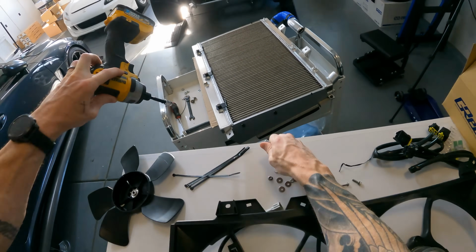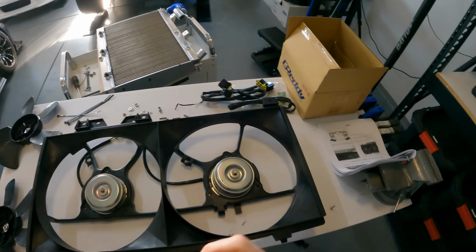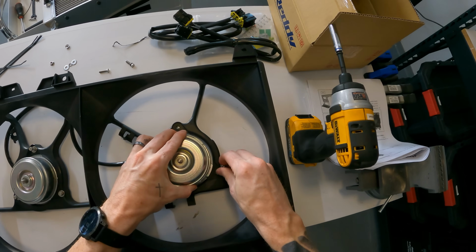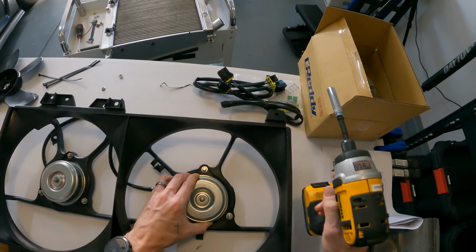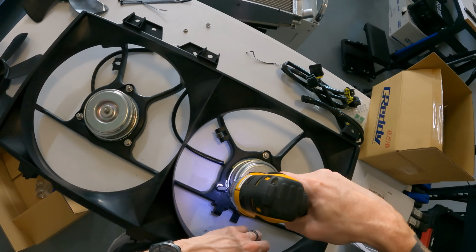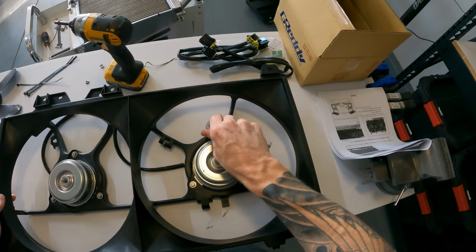But those brackets are spot welded on to the frame rails, and they were just completely missing. That wouldn't be such a big deal if I was also doing something custom, but I'm building a very off-the-shelf sort of car, and the Greddy V-mount, both the radiator and the intercooler, rely on that crossmember as a mounting point. It predominantly holds most of the weight of both cores.